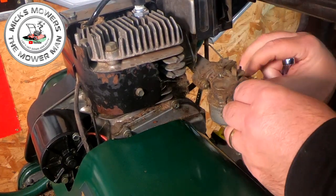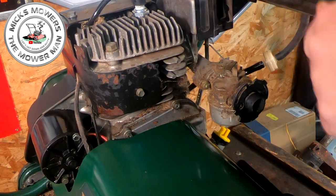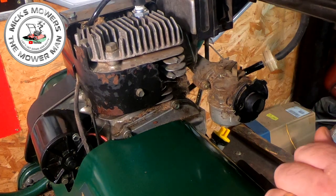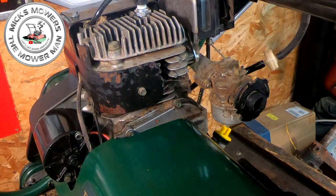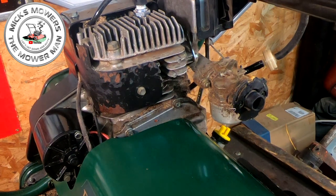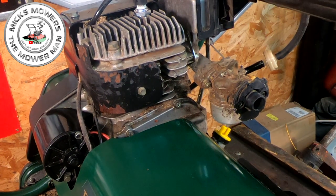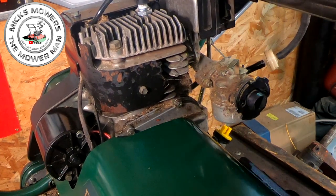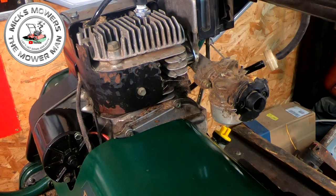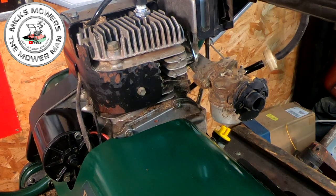There's one around here as well to do. There's only fuel in there first, Mick. I did put fuel in there, yes, see. Can't see, cable in the way. I put some fuel in there yesterday, and I want to see if it's drained out or not. LED light. No, bone dry. And I'm sure I put some fuel in there. Yes, see, I did. So that means it's actually letting by the seat. So that's not very good.